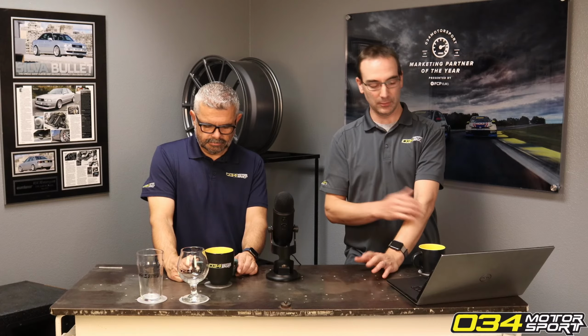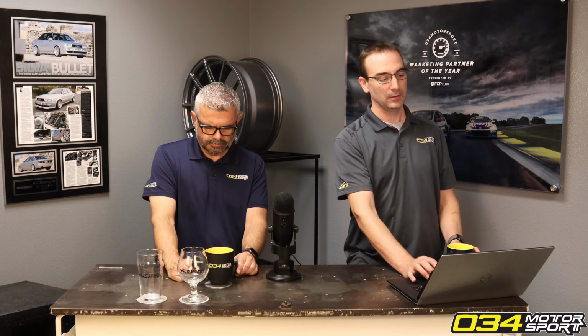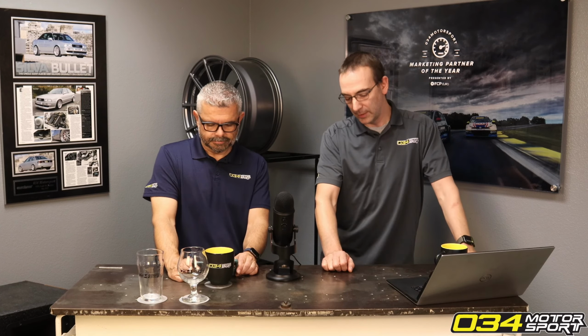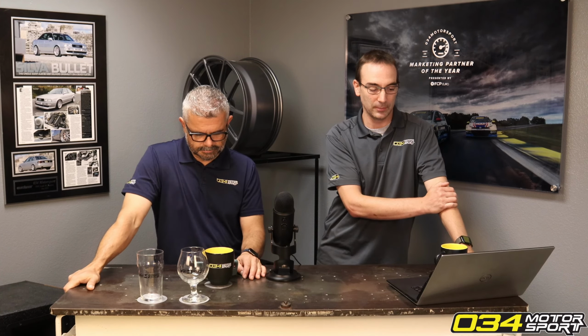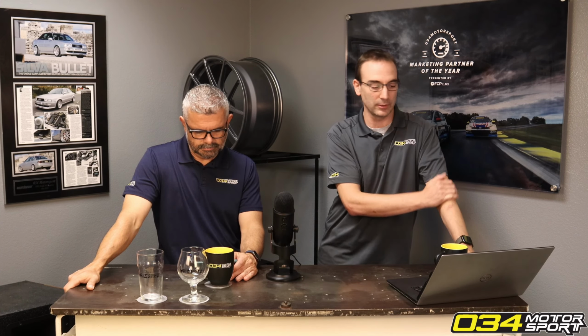If it were a reliability issue on the tuning, in this case with clamping pressures, you'd see things like seals going out or failures in other internal components of the transmission that aren't necessarily gear or actual vehicle movement related. And we haven't seen one of those yet. And it's not like we're just throwing all of the pressure possible at it. We're properly transmitting the torque that's being made from the engine to the transmission. We tell the transmission how to interpret that torque and what to do with it. So it's not running 20 bar of pressure just because it can. It's running the amount of pressure it needs to hold it correctly.